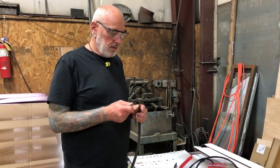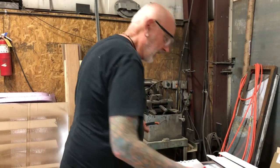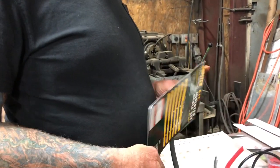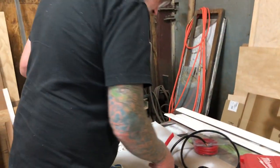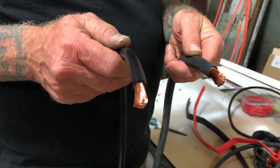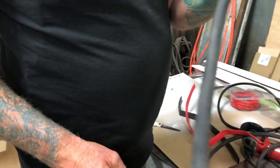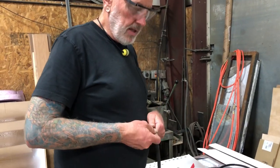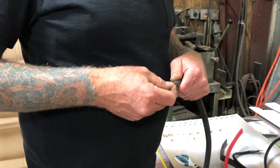I thought I would share - this is the last cable I gotta make. In all honesty, I bought the wrong cable the first time, so don't be confused like I was. I went and bought this at Harbor Freight and I thought I was getting 2/0, but it was number two American wire gauge. To put that in perspective for you, that's number two and that's 2/0. My connectors that I bought didn't work, so I went and got the correct cable.